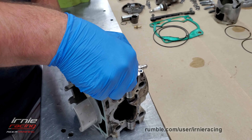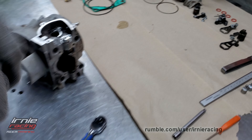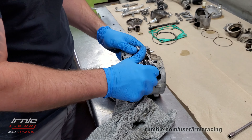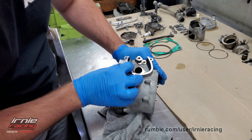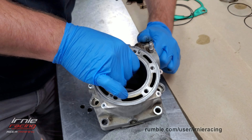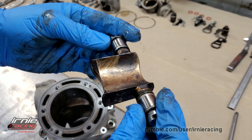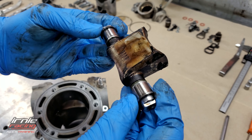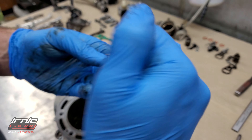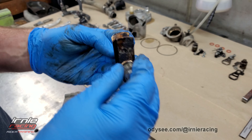This is definitely the most complicated part - you've got to remember where the pieces go. And then this will pop out - it's in there a little tight, just kind of pops out. And that's your power valve. Not that bad - nothing getting debris locked or anything. But that's what they normally clog up - here on the sides. And that causes it from not opening fully or closing down fully.